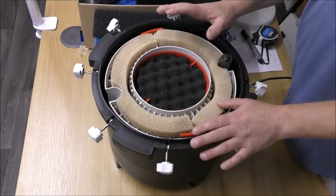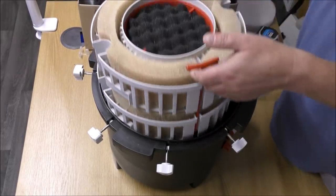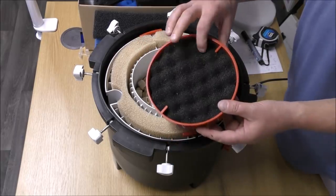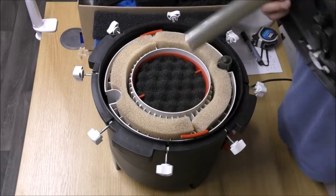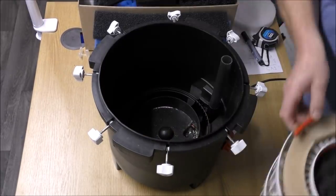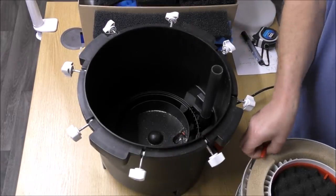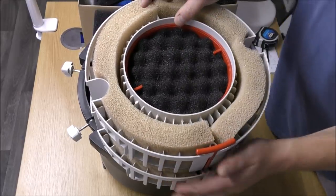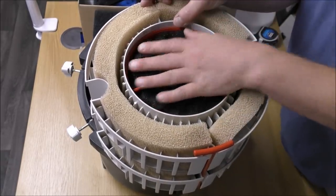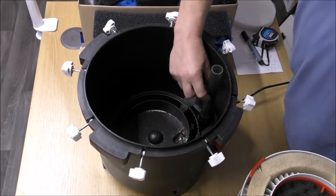This just looks exactly the same as an FX5 or an FX6 in that we've got two coarse foams around the outside here, and we've then got the trays. This one has got two main trays, but it's also got something called an in-tray system, which is basically a smaller tray that fits inside the main tray. Just a brief overview of how this works: water comes in here, down this pipe, to the bottom of our filter, where it swills around and around. It then passes through the foams, up between the foam and the tray. See these fins here? That allows water to travel up over, then the water goes down through the trays, and it's drawn out by the pump and spat back out to the tank.